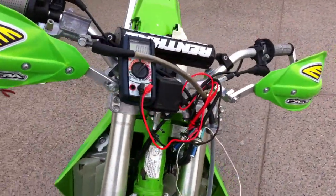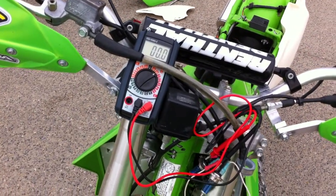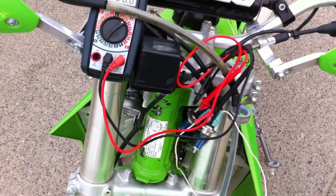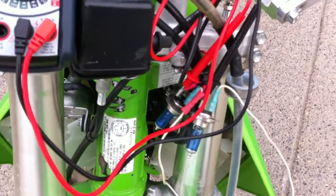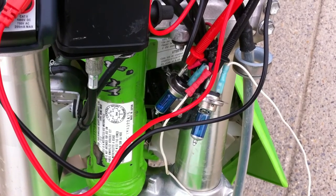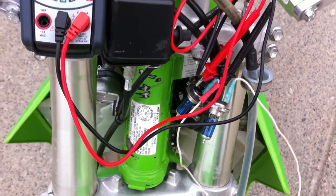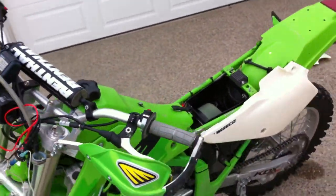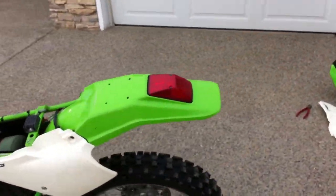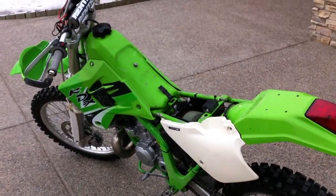Got another AC-DC multimeter set up to show AC volts, and that is wired in to two 55 watt H7 car headlight bulbs. Those are wired in series and the voltage reading will be taken directly from them. In addition to the two 55 watt bulbs, the stock 10 watt taillight bulb is in place, so that should give us a total draw of about 120 watts.